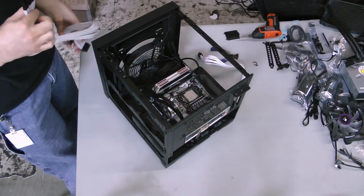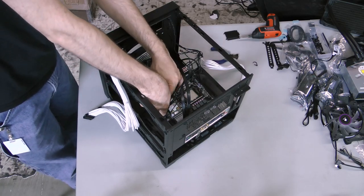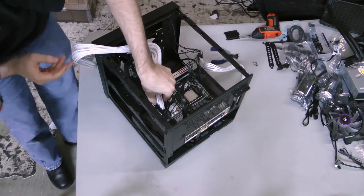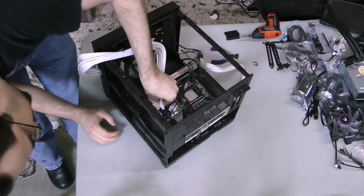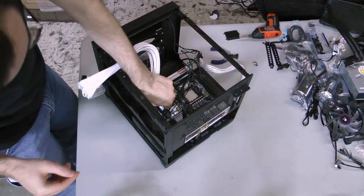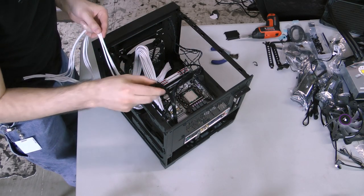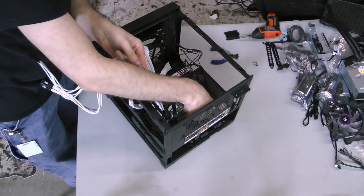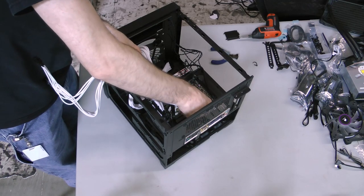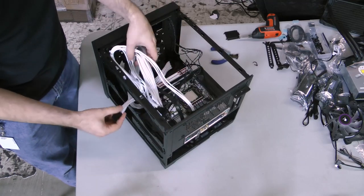Using a modular power supply can make assembly in the 250D much easier. I'm going to connect the power cables to the motherboard in advance and route them through the power supply bay so that when it's time to install the power supply, all I have to do is connect the cables to the unit itself. First, take the beefy 24-pin cable and snap it into the port on the motherboard — this may take some pressure, doubly so if you're using individually sleeved cables. Then install the auxiliary 12 volt cable for the CPU. This connector tends to be split into two fours; most motherboards use all eight pins, but the board I'm using only needs four, so I've split the connector. Plug in the properly keyed connector, then route the cables down into the bottom cable well of the case.